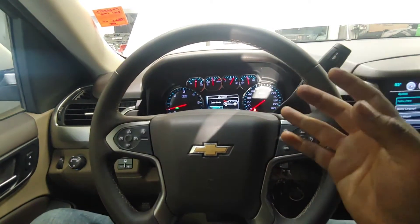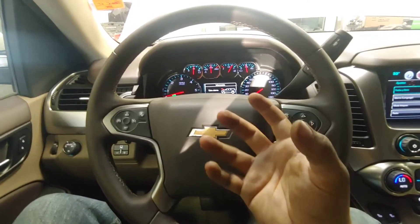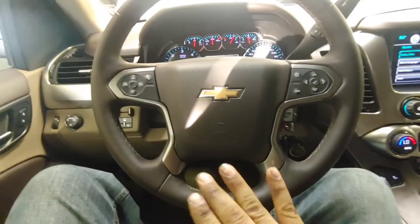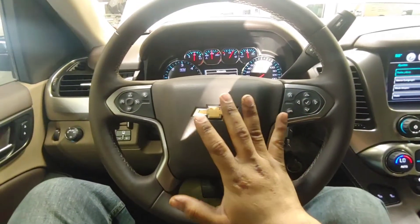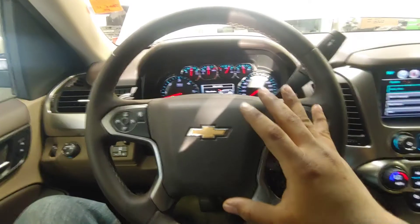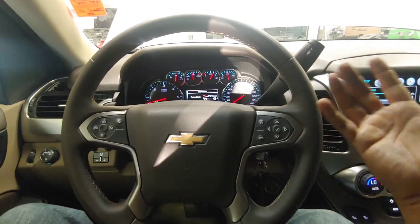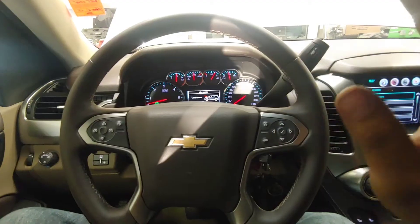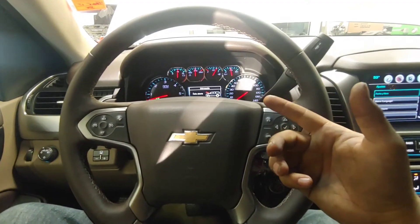Typically the way this works is you've got your brake booster — it contains the vacuum, it holds the vacuum. The engine creates the vacuum, and this vacuum is what assists the brake pedal in going down. Just imagine it helping you suck the pedal down to the floor. Usually GM has the vacuum just coming off of the engine because it creates an infinite amount of vacuum.